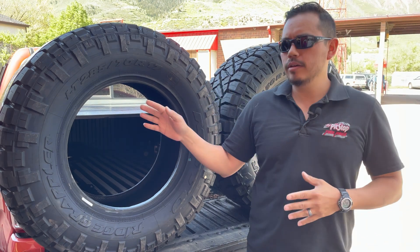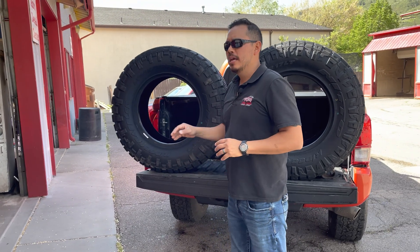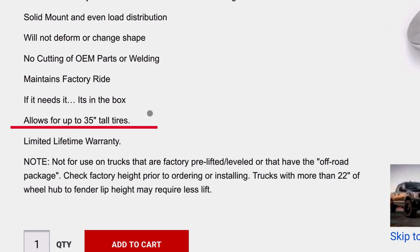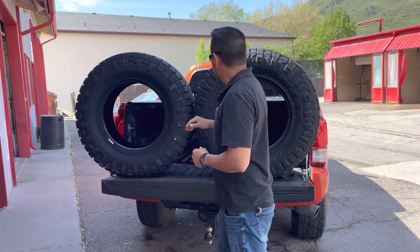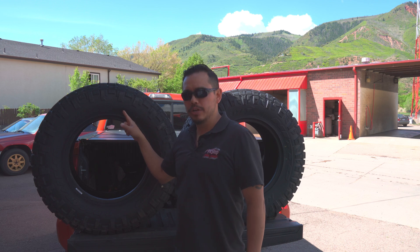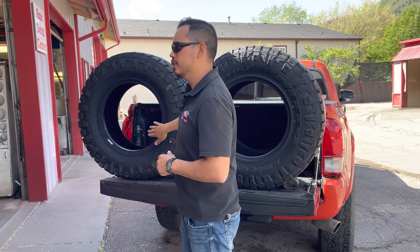On today's episode we're talking about aspect ratios of tires. Knowing how to calculate this aspect ratio is important because when you lift your vehicle, most manufacturers will say in the installation guidelines that the maximum tire size or tire height will be 33 or 35 inches. Not all tires come in this standard sizing like 33/1250/17 — they're mostly in this aspect ratio format. So knowing how to calculate this to get the right tire size onto your new lift kit is extremely important.